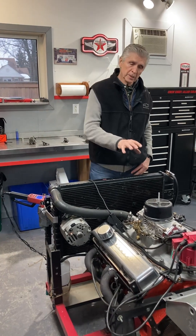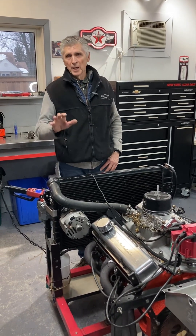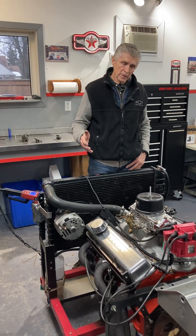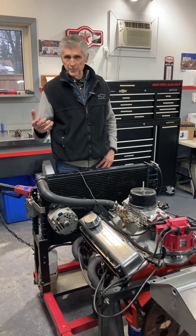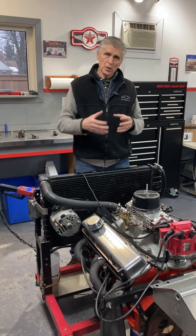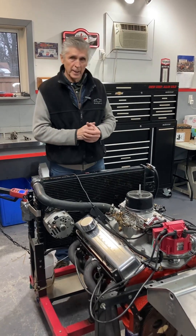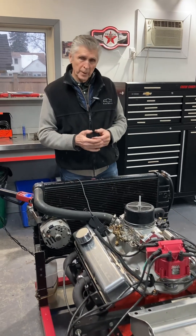I applied it to this engine when it came back. When it came in, the oil pressure was low and the camshaft was getting noisy. We took the camshaft out, and in a previous video I showed the lobes — all of them were rounded off a bit, none of them wiped right out as is fairly common. That made me suspicious. The other indication was oil pressure at idle was less than 5 psi when the oil was hot. The camshaft is the only part in the engine with direct metal-to-metal contact, so it needs oil splash to lubricate and take the heat away. At 5 psi, it's not going to get that.